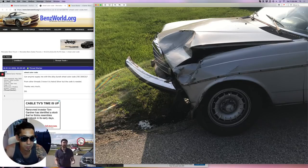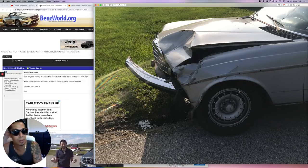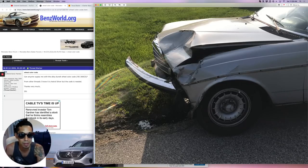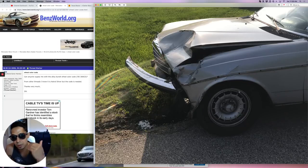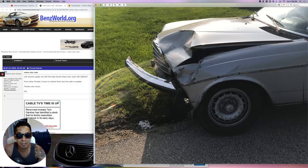And through my experience, I found that single stage paint jobs are very durable on rims. That means basically a 2K product, just an acrylic enamel paint on your rims, and even a light coat of base coat clear coat. So if you're going to be doing a base coat clear coat, I would definitely media blast, epoxy prime, sand, light coat the base coat and clear coat, and you're good to go. All right, that's how I would handle it.